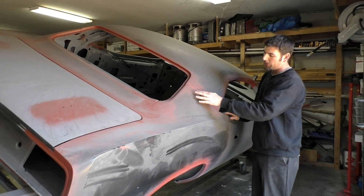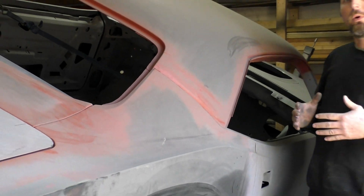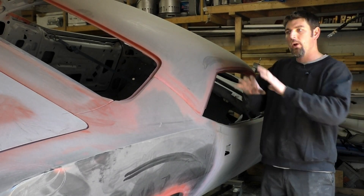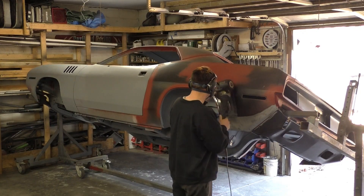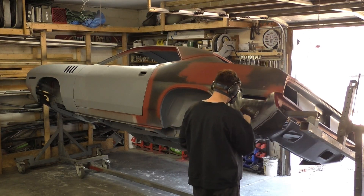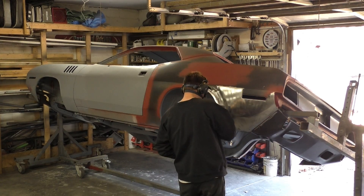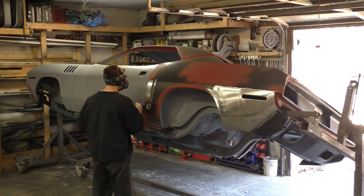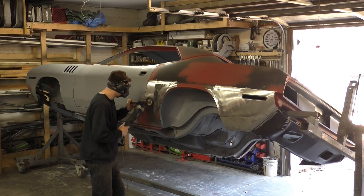You can see right here that's going to be one of the main channels we're going to have to really focus on getting in. It's on the rotisserie so working and stripping the car at this point is going to be easier now than it was earlier. Stripping out this Barracuda we're going to use the Eastwood SCT on this project. There's other ways — a DA — that you could strip this car. I'm using the black stripping drum here. The red drum will work also. There's a drum with sandpaper, that's another way to do it. Right now I think with the e-coat the black drum works the best.